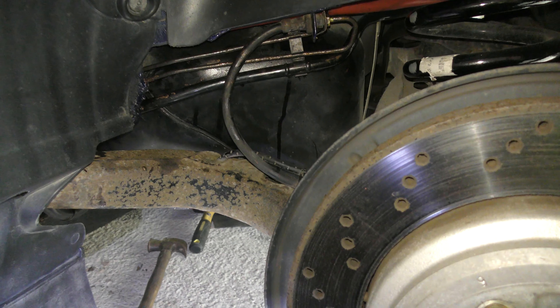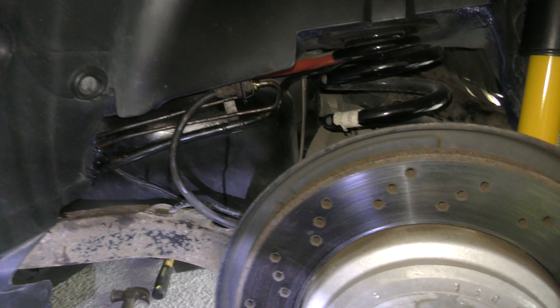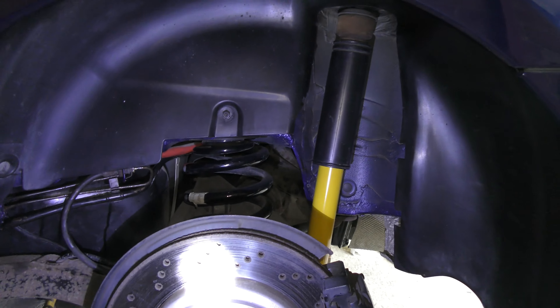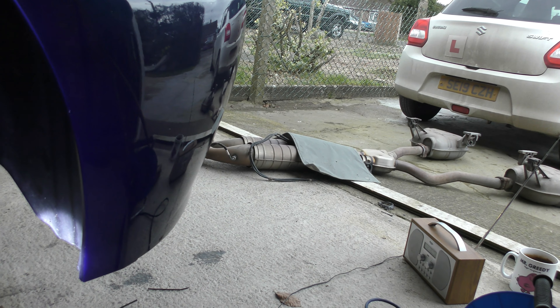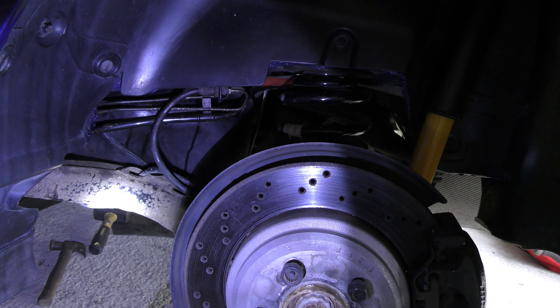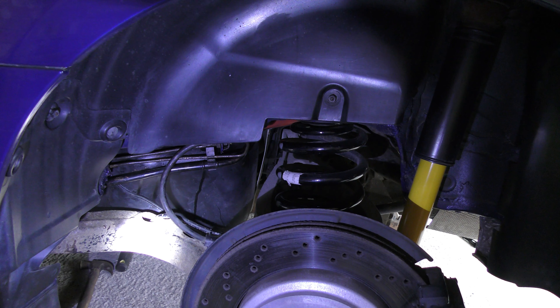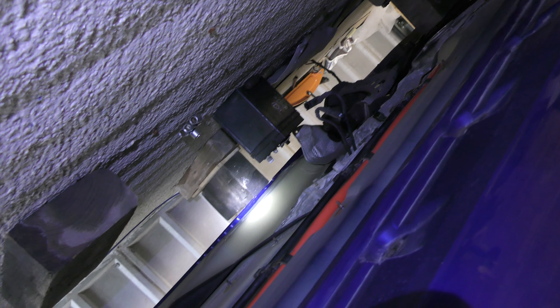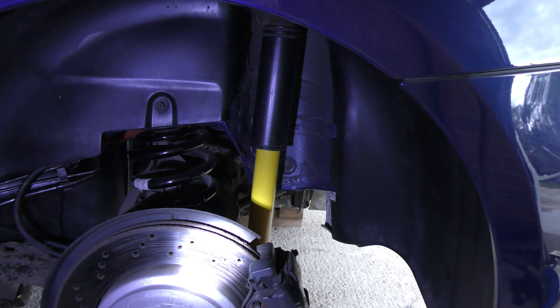Next things I've got to do: I've just got to repeat on the front — fit the rear front guards, which I'll probably do next week. The next stages are: find a way of removing that diff — there will be a way — so I'll start on that next week. That diff's got to come off and we've got to do the front oil seal on it. The exhaust needs sorting out too — whether I'm going to replace bits or however I'm going to do it, I don't know. So as a reminder of what we've done: we've whipped everything off the bottom — all the covers, heat shields, all the splash guards. Everything's been cleaned out. Where we've found surface rust we've stripped it down, treated it and painted it, including all under the body. The brake lines have been treated all the way along as best I can — it's going to give them a few more years. The underside of the car is lovely now. That'll do it for the stage one refurb, and we will crack on with the diff next week.